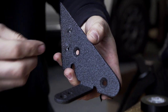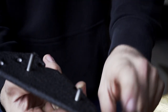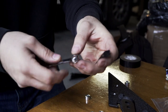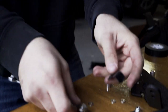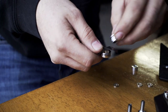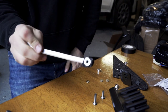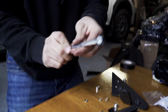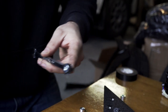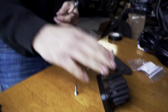On the passenger side, the long screw goes on the top and the short screw goes on the bottom. Flip it over — the long screw gets the spacer. You need to sneak the bracket behind the fender, so take some tape, place it on the nut like so, wedge the nut in so it's almost captive and can't fall out. Then reach it up behind the fender and install the bolt using the same allen key you used to attach the bracket to the light.